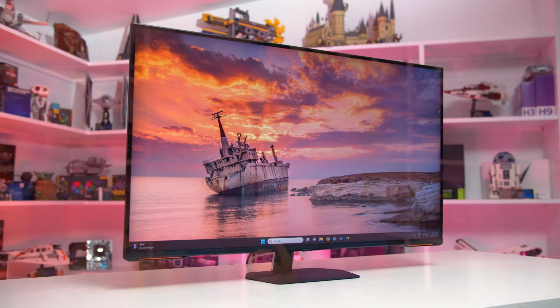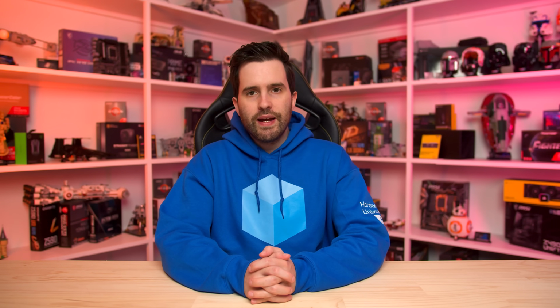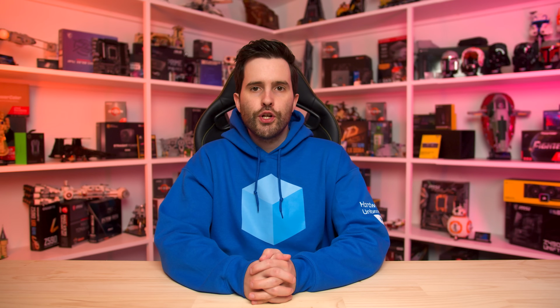for productivity. There is an enormous downside to the Neo G7 LS43 though, and that's motion performance, which is dead set atrocious for a 144Hz gaming-oriented product. Even with 3 overdrive settings, this display simply isn't capable of decent speed and is nowhere near the performance of the 32-inch Neo G7, which also uses VA technology and is made by Samsung.